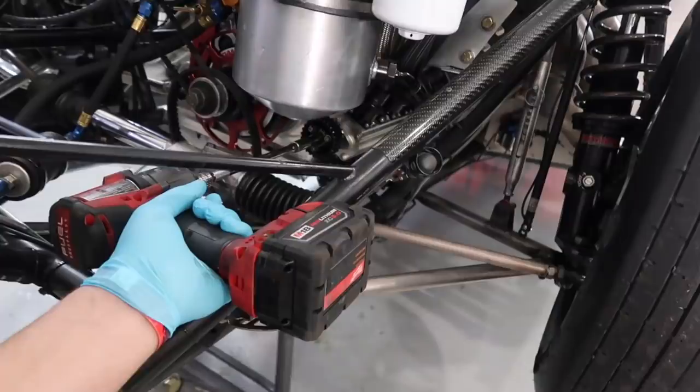Guys, like I told y'all in the previous video, you gotta make sure with these big motors, you should do it with every motor, but you gotta prime them up before the initial first startup. So that's what I'm doing right now. Just get a drill on the end of the pump, prime it up, just make sure it gets a bunch of oil.